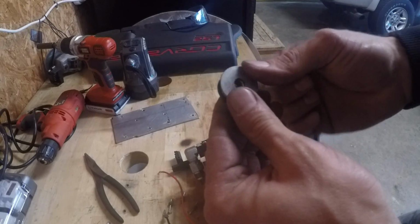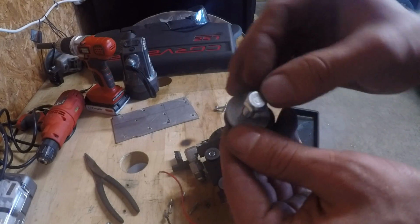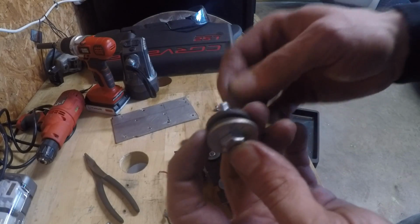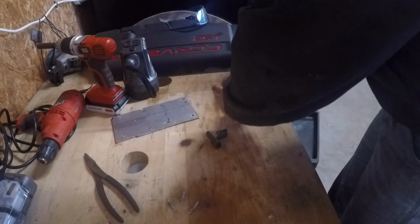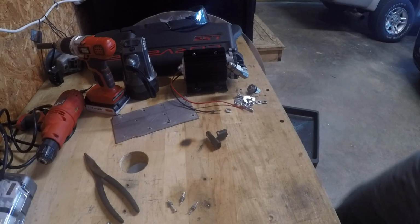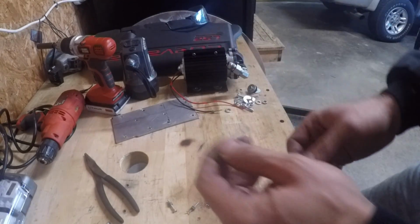So I would recommend using a really big washer that covers up the entire grommet so that whenever you put your bolt through there, it's going to pinch on the washer and there's no way your pump can fall off of your grommet. So that's one thing that I really like about this TURBOWERX pump, other than the fact that it's quieter and lighter. The other thing that's just tickled me pink is that they included these weather pack connectors.